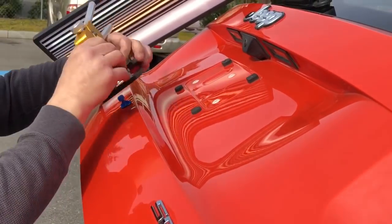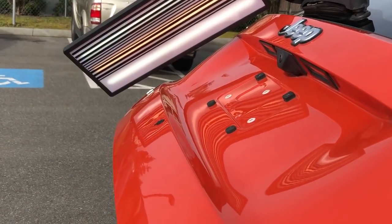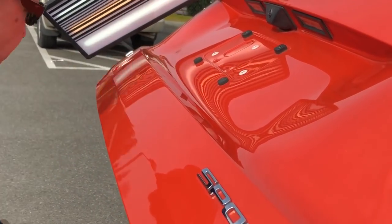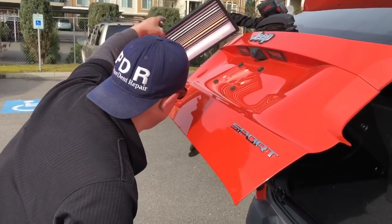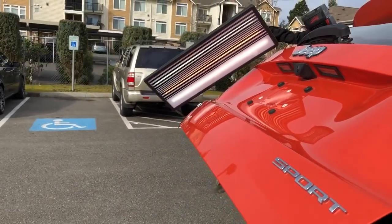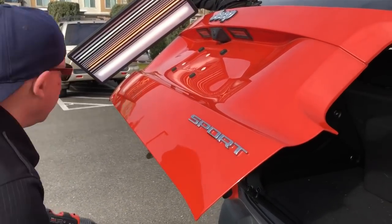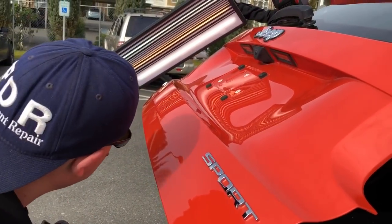I want to come from the top and just give it a real soft pull — I waited a little too long on that one. We were getting ready to film. Let's just see how much of this dent has come out with just glue pulling so far — quite a bit. It still has this line, and if you get enough angle on it you'll see — but it's got a low right here. Let me try to make one good solid glue pull. Grab the quality tab, the glue is still nice and hot.